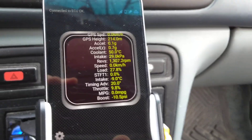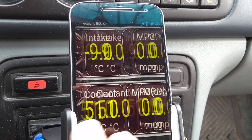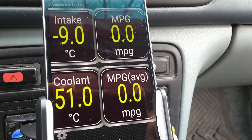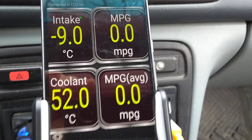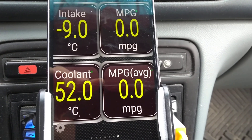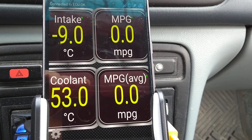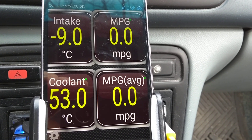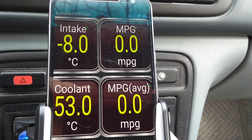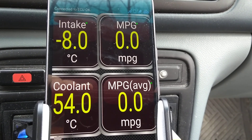What I'd really like to see when I'm driving is that the intake temperature is really really low but the coolant temperature starts to get higher. One of the things living in Winnipeg we've always noticed is that gas mileage is always a lot worse in wintertime. So I started thinking: what if we could preheat the air intake, and what if we could preheat the fuel using the temperature off of the coolant?